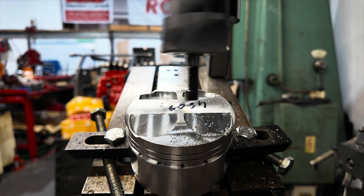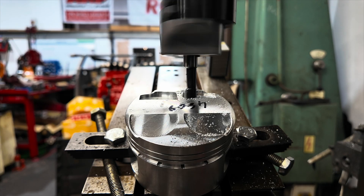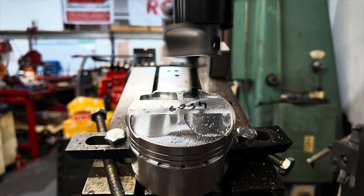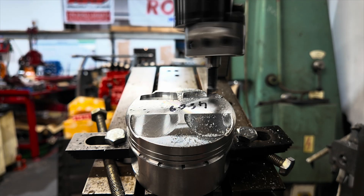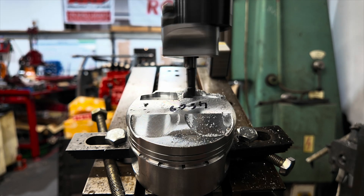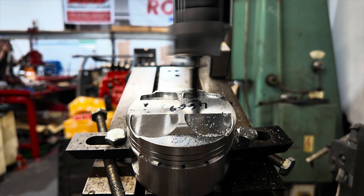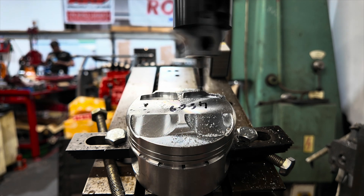The first cut I just do to know that it's cutting fine, and I can watch the cutter run along the valve relief - the original valve relief. If I need to make any really slight adjustments I can, but I don't, it's all good. Then I watch the very back part of the valve relief to know that my zero on the travel is right in the corner of the valve relief I'm going into - which is just about there. I can see it cut in the corner so I'm about perfect, so I'm going to wind it out.